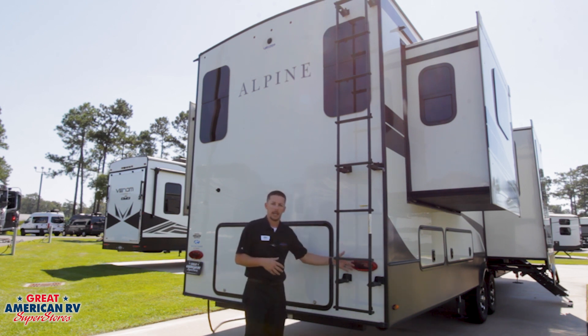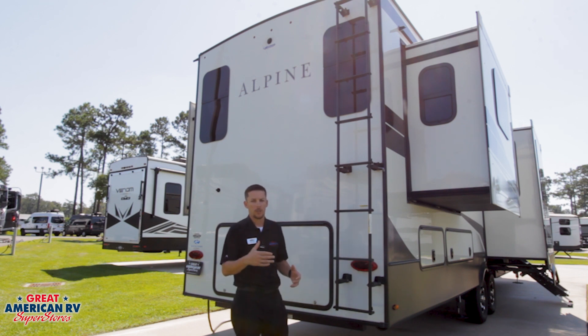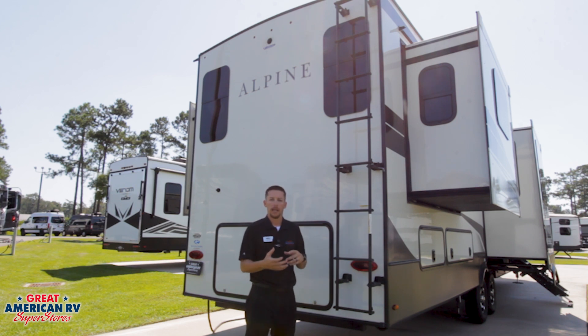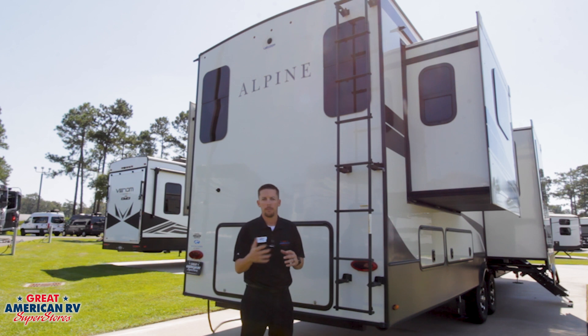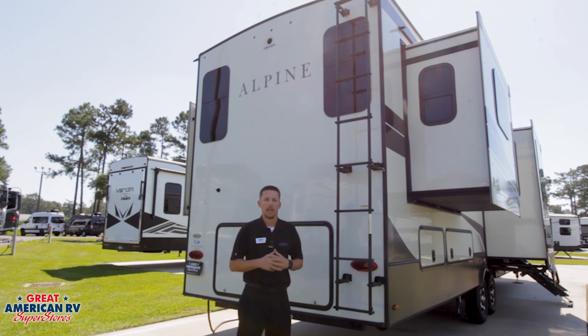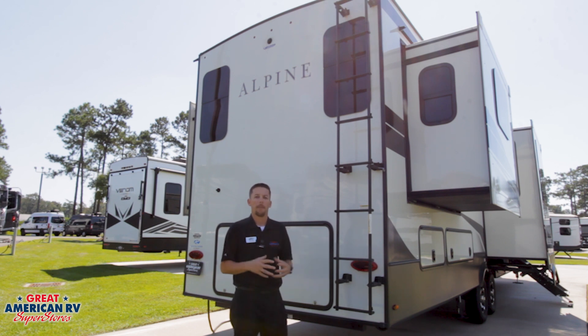In the event that some of these lights don't work, you want to first check the fuses on your truck that you're using to tow this unit with, and look for any trailer lights or anything of that nature — brake lights, backup lamps, anything that would indicate trailer. You want to check those fuses on that vehicle to ensure that they are not blown.